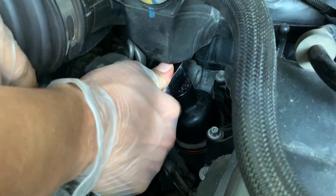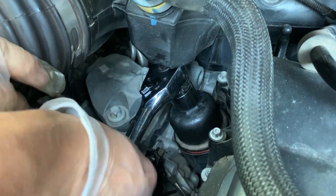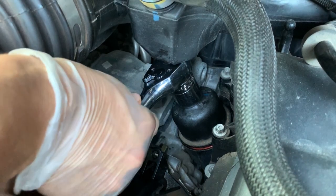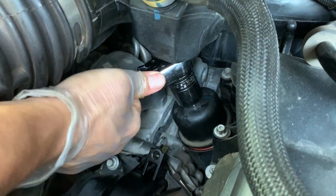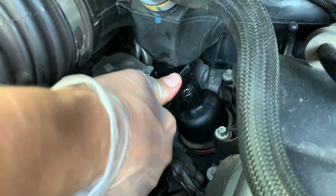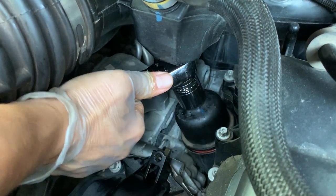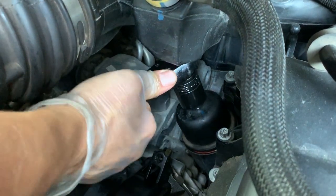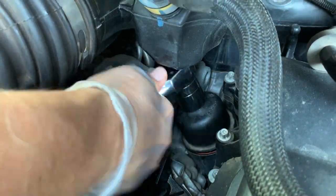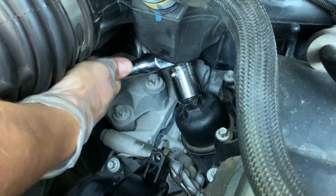This top is plastic so we don't want to over-tighten it. The shorter the wrench you can use in here the bigger turns you can get, so if you've got a long wrench you're going to have to have some patience and make quite a few turns to get this tight. You may have to lift up on the hose a little bit as well. Once you've got the oil filter cap back on, it's time to climb back underneath and put in your drain plug.